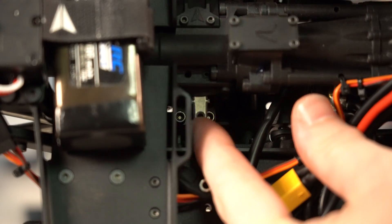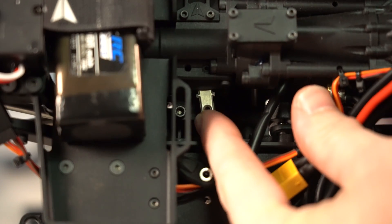If you don't want to add the extra servo for the dig unit, it can be mechanically selected on the transmission just like the overdrive — just put the dig lever in the desired position and lock it down with a set screw.